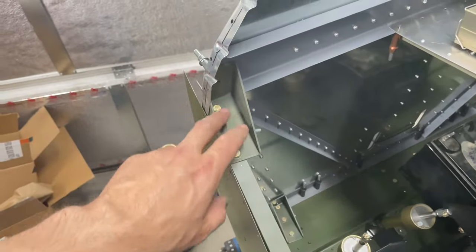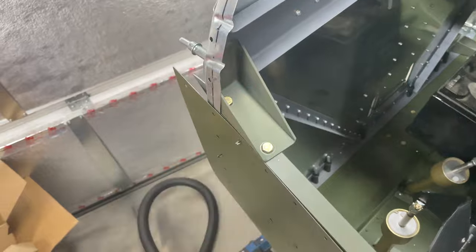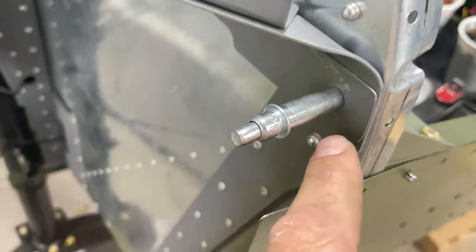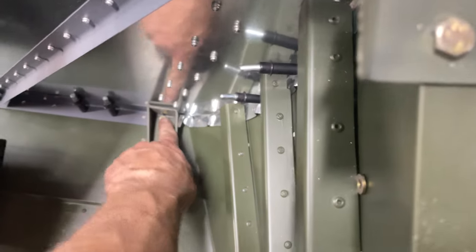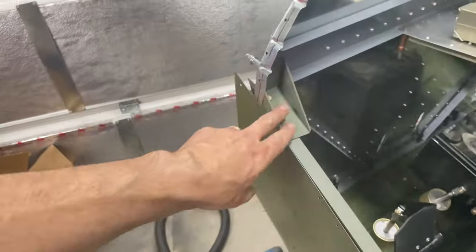The engine mount doubler pieces are in place. I didn't open up the holes in here yet — left those as number 40s because I don't know exactly where everything is going to fit and what size the engine mount bolts need to be. Other than that, they are in and sealed with self-etching primer. I do have the countersunk screw down in here and the standard bolts up there, so that's good to go. The firewall is still removable even with these in place.